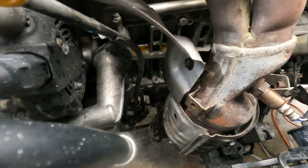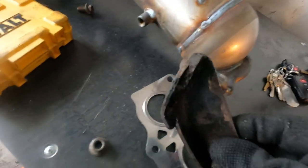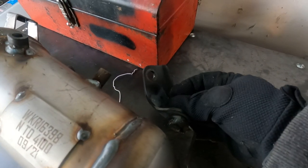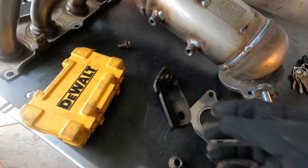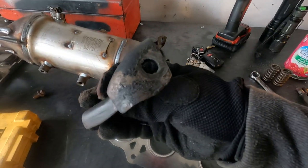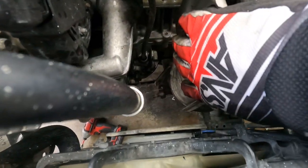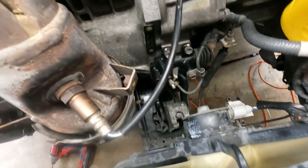Quick progress update. On the manifold there are two brackets, one on each side — one goes here and one goes to the block, same thing on the other side. Both of these were bolted on here but they weren't secured to the block, so this was just vibrating up against the block. When I drove the car I heard a metal-on-metal rattling and I'm assuming that's what it was from — you can see where it's been beaten. Anyway, it's supposed to go to the stud down there and into the hole — that wasn't done on either side.